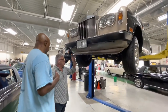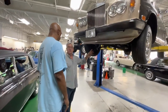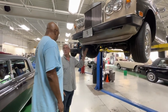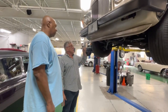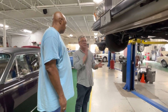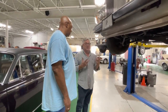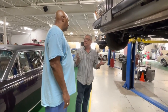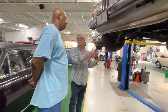For the Shadow, I prefer to stick to the original type. There is a new disposable type, but I'm not really into those. On the Z version, of course, they're disposable. Now, for owners out there — if you can get 10 depressions of your brake pedal before the light comes on, that is telling you it's time to start thinking about it, because that's getting low. That doesn't mean you're in the danger zone yet. We wouldn't let a car go out that we sold with only 10.